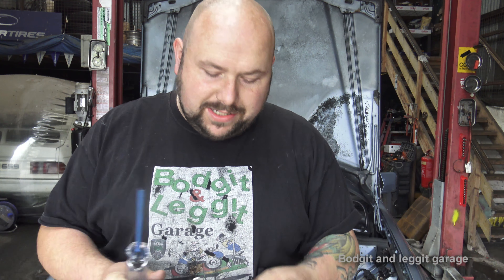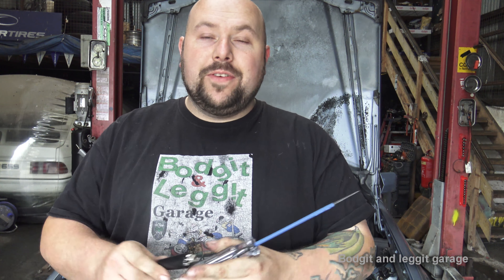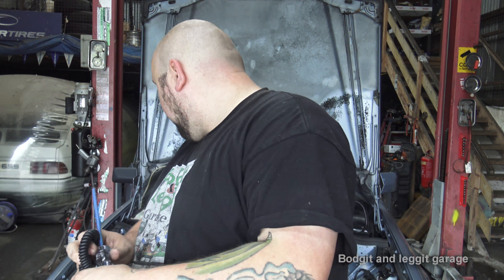I should have made it clearer in the first video, but the key point is: before doing this test on any car, make sure your battery and charging system is good first. If your charging system or battery isn't good, there's no point doing a draw test - you need to fix that first. If you've had a draw for a long time it will damage your battery. On these old cars you can use a very simple test light. The alarm in this car was complicated, but you get the idea of how to find a draw.